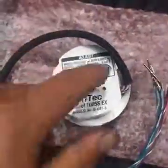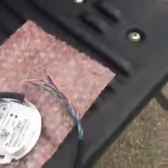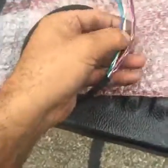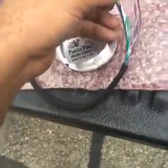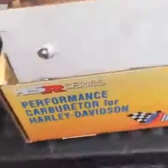And then you got your RPM limit. You go to 1,000 and then by 100 again. And it comes with everything. You've got to wire this up with the Deutsch connectors and new wires. Then, right here, that pink wire right there, you can wire it up to plug into the PC. So you can actually set your own custom advanced slopes, almost kind of like a power band with a dirt bike. You can control when that kicks in, fully tunable, as well as with this Mikuni. It's a Mikuni 42 millimeter flat slide carburetor.